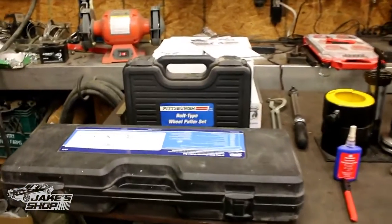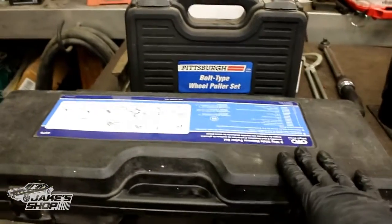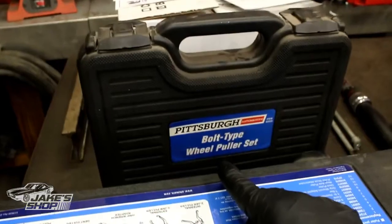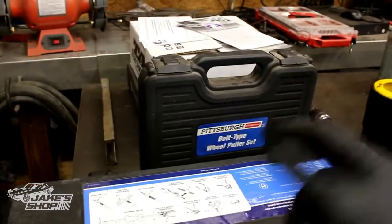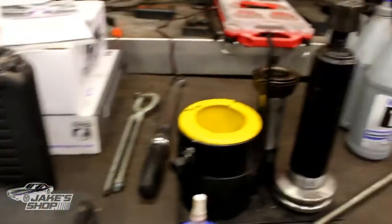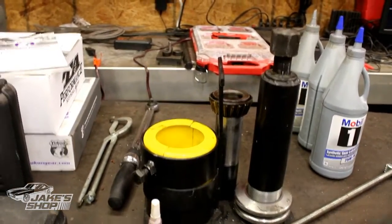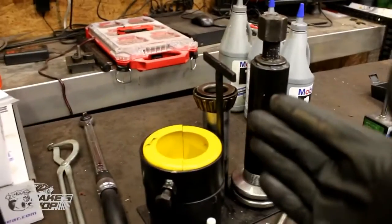We'll go over a few of the tools you're going to need. Some of these are specialty tools you'll definitely need, and some you might be able to live without. This is a slide hammer — great for pulling seals on axles, especially on a c-clip style axle. This particular build I wouldn't be using this because it's a non-c-clip build. This is a bolt type wheel puller — I actually use this to pull the old pinion yoke off. Those old yokes are kind of wedged in there and stuck. This is a pinion bearing puller; they make cheaper versions you can use in your press.